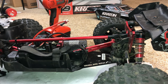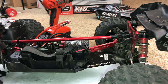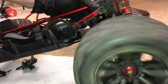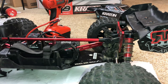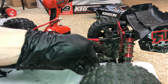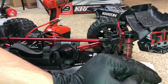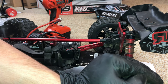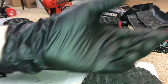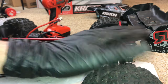I don't know what I'm going to do. I might just end it here and put this back together because I honestly have no idea. There was some teeth - little bits of teeth that were chipped - but I wouldn't think it would make that much noise. Maybe I'll have to wait for Arma to send me that limited slip diff. The issue is not with the spool, so it must be somehow the gear mesh between the teeth and the pinion in the rear diff. Maybe the pinion is chipped - I guess I didn't pull the pinion out.